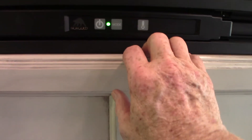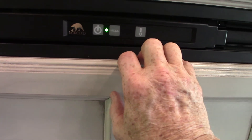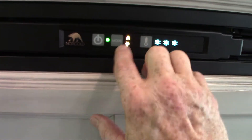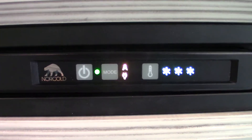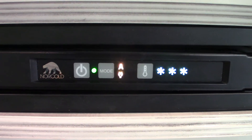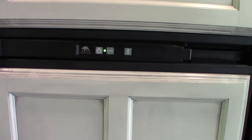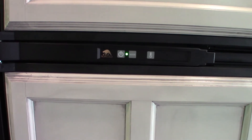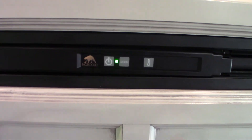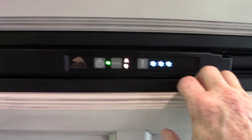Your refrigerator here is a gas-absorption refrigerator. It works on 110 AC, just like regular shore power, and it'll also work on LP gas — you select the mode. It's set to auto-electric right now, which is the most common way to use it. In auto-electric mode, it always seeks out electricity first. If it can't find electricity, it'll automatically switch over and light on gas. Or, if you're camping and the power goes out in the campground while you're away, it'll sense that and automatically switch over to gas so you don't spoil your food.